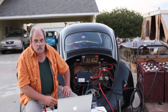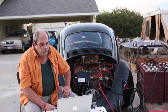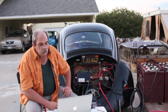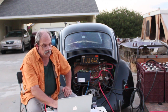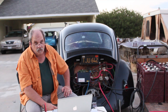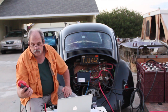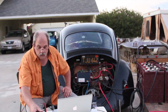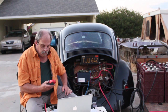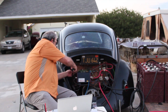I'm just going to let this thing run for a while. Since it's high voltage, it's going to take a little bit to charge. The current going into the battery looks like 20 amps, so I'm going to bump this up a little bit to get it going faster. Let's check the current — I have the ability to check current here. Let's do 40 amps — checking amps going into my battery.